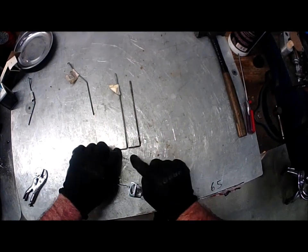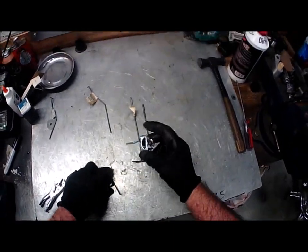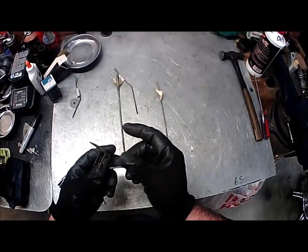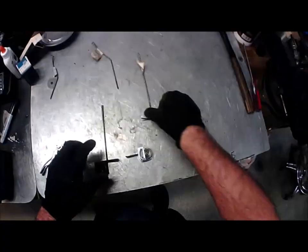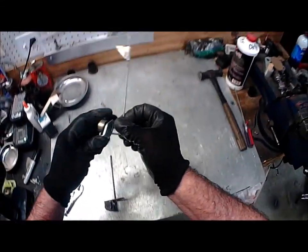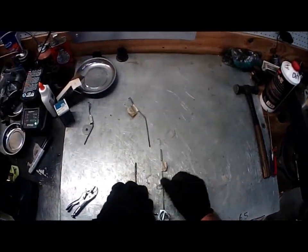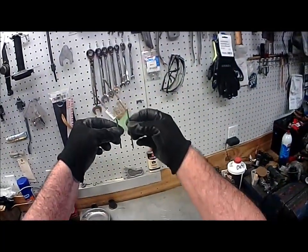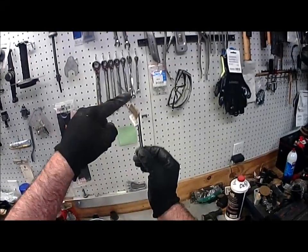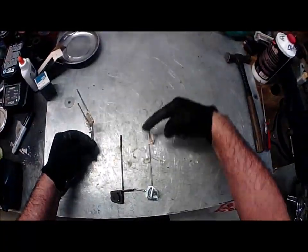This is an NOS one right here. So when they made this longer choke rod, they offset the coil a little bit. If you look at these things and put them side by side — to offset that, they created a different upper choke rod. The early model one is about an inch longer, and the late model one is about an inch shorter. That is to make up for the difference in these choke rods here.